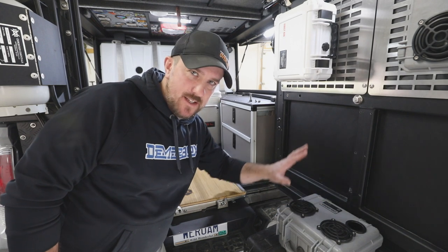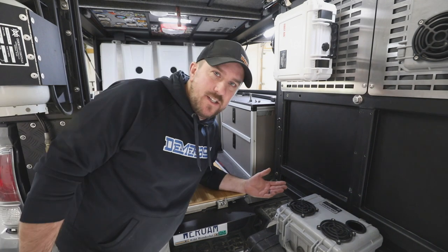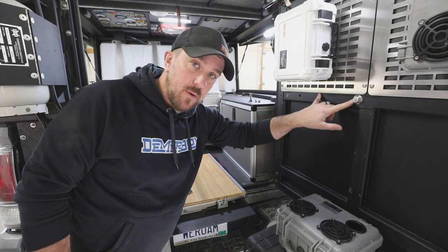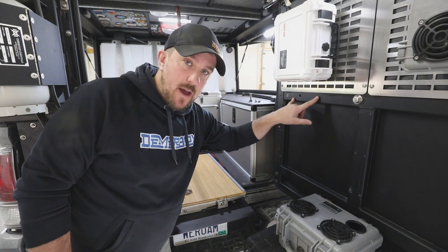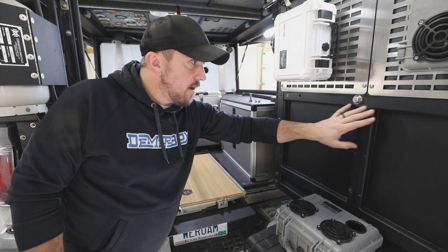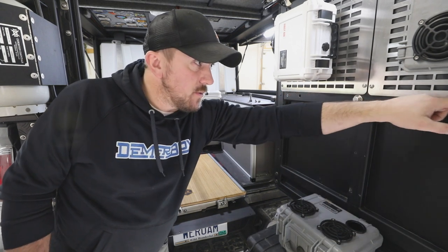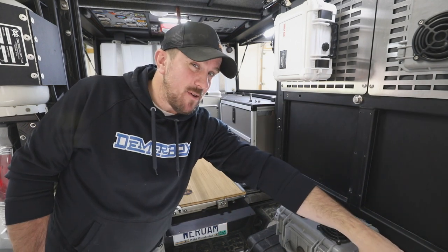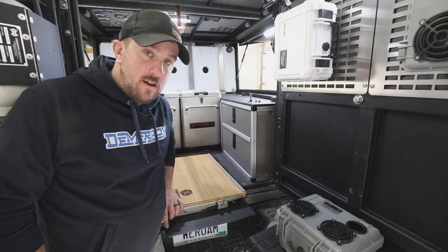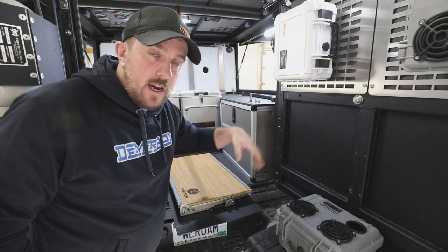I've been laying things out, sizing up where to put this and how to center it on the door. I even called AJ at GP Factor, but it honestly comes down to personal preference. You should consider whether you have a traction board mounting kit or a spare tire mount on the back door. To give myself flexibility for later changes, I'm going to center this dead-on on the back door, lift it up so it's flush with the existing molle panels, and use one of the bottom rivet holes to lock it in place before sinking all the rivets.